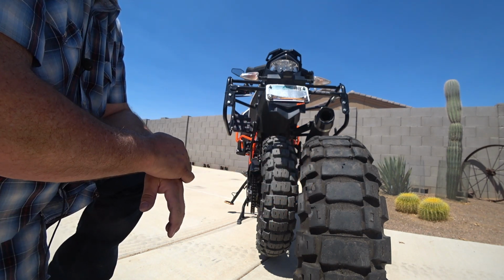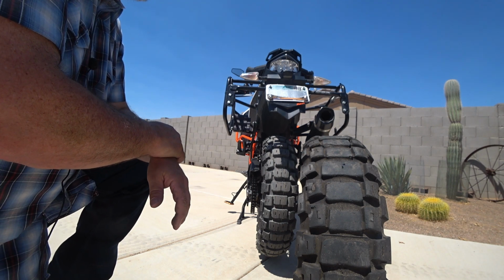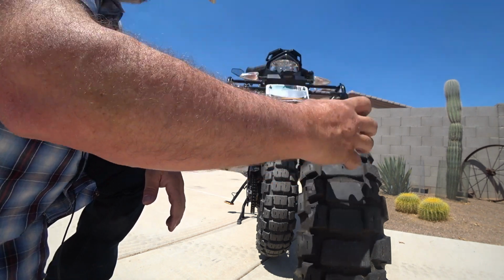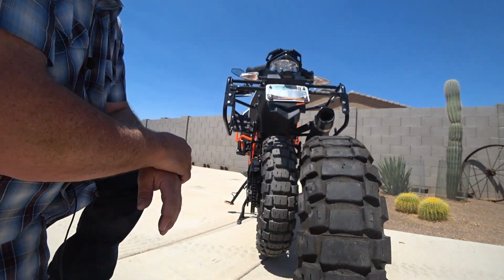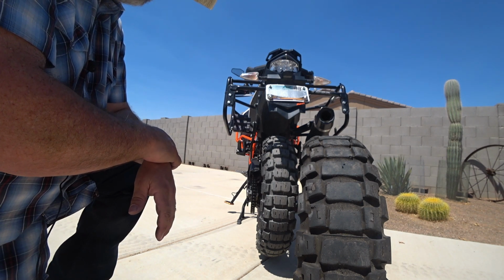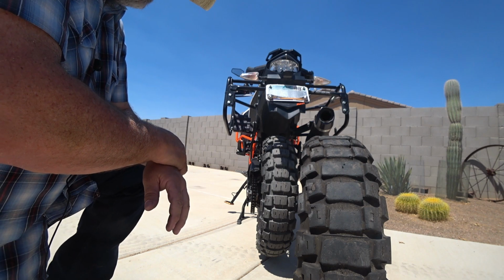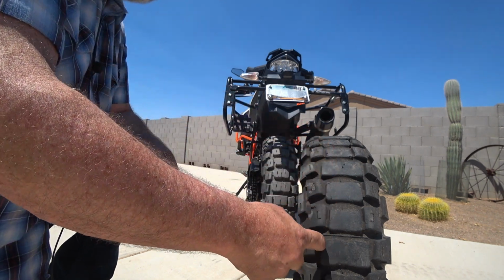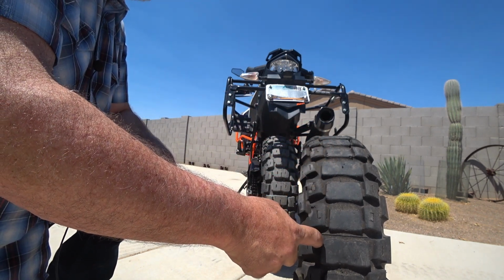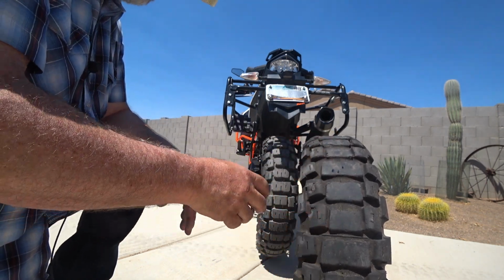And the first one I had that issue where it came off the bead, I actually had to get recovered, but getting it home, even at home, I went to a couple of bike shops, they couldn't get it. And what I ended up doing was exactly that, putting a strap around the outside and hitting it with a good chunk of air. And that's got the bead to set. I got about another 1,000 more miles on it, but the splits were causing an issue. So I changed to this tire, and I had no issues with that afterwards.